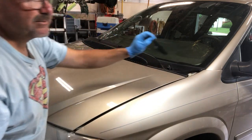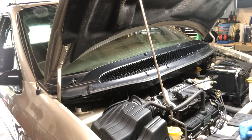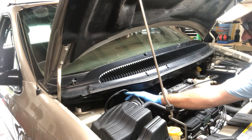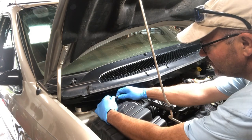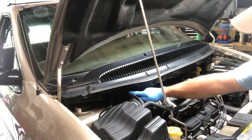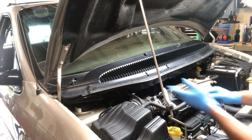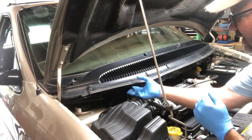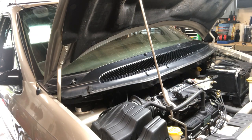Take that broken end piece out. Now pop open the hood. The last step before removing the cowling is over on this side — this line is your washer fluid line that runs up to the sprayers under the windshield. Just pull those two apart. Follow it underneath to where there's a little rubber grommet inside the wiper motor pan — push on it so it pokes up inside, because this line connects up to your cowling.